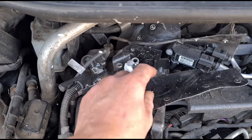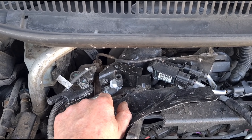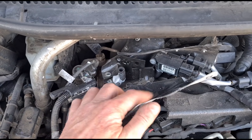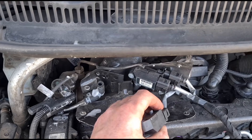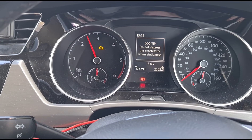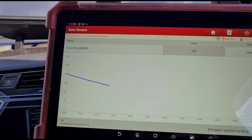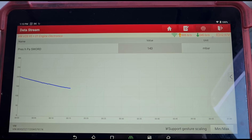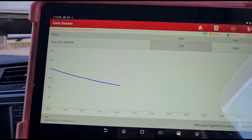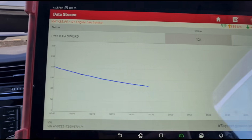Now we've disconnected that. We'll just make sure that that pipe is cleared out of any of the suds that are coming out, making sure they've all cleared before we get the sensor reconnected. Now back in the vehicle — I'm going to hold the revs up. The max on this is 2500 RPM. So now I've got the DPF pressure on the chart here, we're just watching it come down, holding the revs at 2500 RPM.